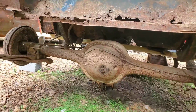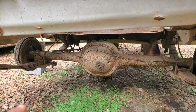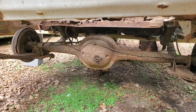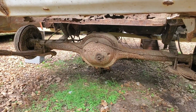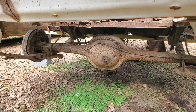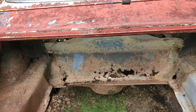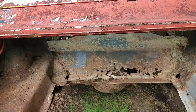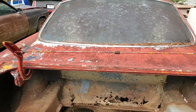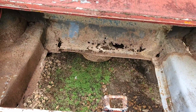We're using all the running gear on the Ranger. The worst case scenario here, on a side note, will be me taking this rear end and cutting and re-welding the spring mounts and shock mounts on it so it could fit right on the Ranger chassis. Since this is a different ratio rear end, which allows me to use a 3-speed transmission, we don't end up having this thing revving at 3,500 RPM at highway speed. But for the time being, we just need to get everything cleared from this body, so we'll worry about that later. This is what we've got to worry about right now. So let me get some tools and start cutting.